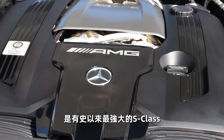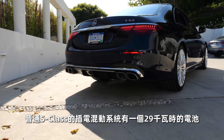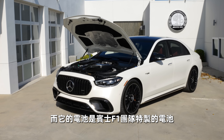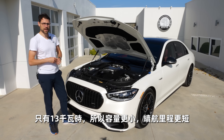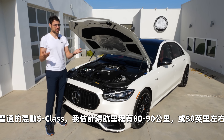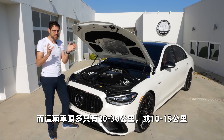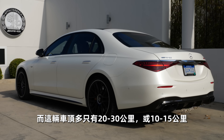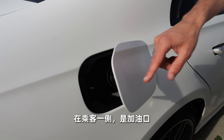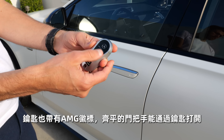Under the hood, we have the 4.0-liter V8 bi-turbo. Together with the electric drive, we have 800 horsepower of system output — the strongest S-Class ever. 3.3 seconds is the 0 to 62 mph acceleration figure. How do they achieve that? The normal plug-in hybrid S-Class has a battery capacity of around 29 kilowatt-hours. This battery here is a performance battery inspired by Formula One tech from their racing team — 13 kilowatt-hours, so less than half the capacity. That also means less pure electric range: around 80–90 km with the normal S-Class PHEV, but only about 20–30 km here. On the other hand, you have better recuperation and stronger horsepower output. That's the pro and con of this system.